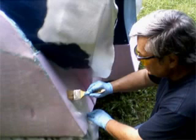Make sure you sand the fiberglass between layups and then clean thoroughly to remove all dust and moisture. This will help ensure the second layer bonds to the first layer. Continue this process until you have reached the desired thickness. Again, usually 2 or at most 3 layers will be sufficient.